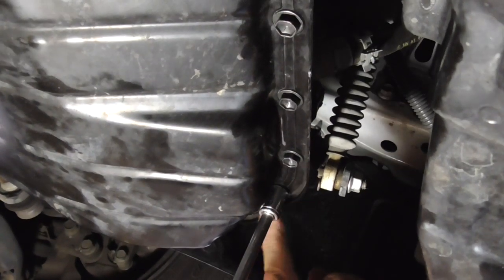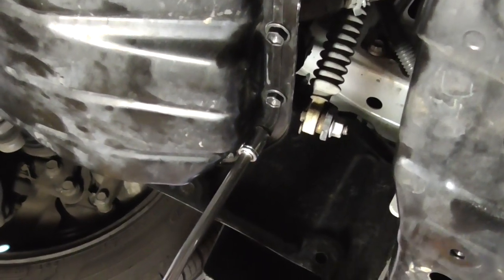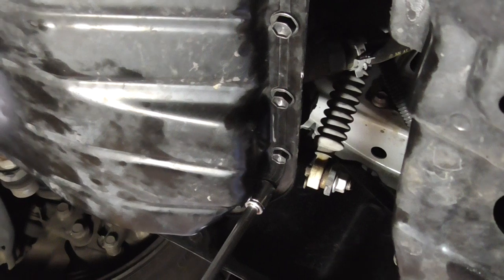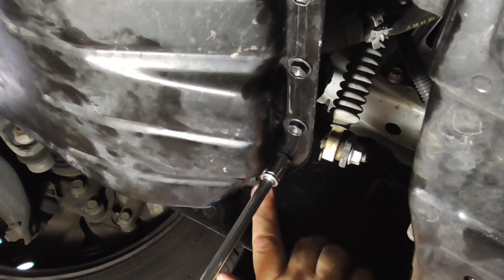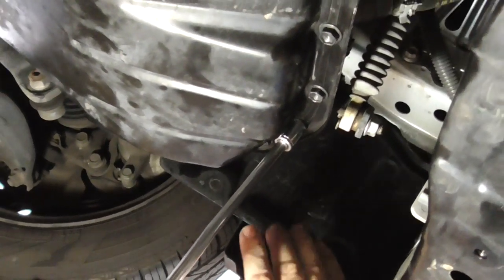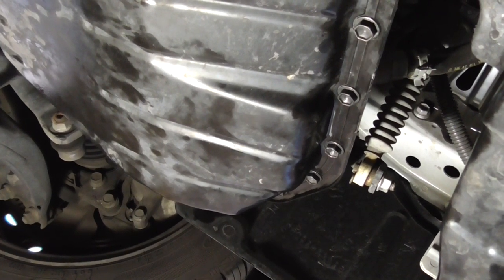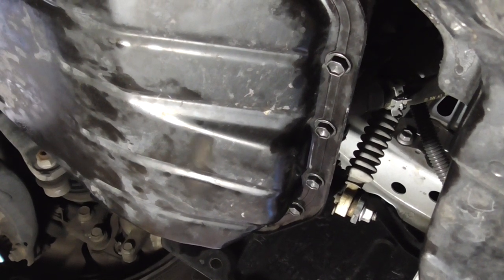We've just been around — about four full circuits — tweaking the bolts up so they're all about the same all the way around. Every time you go around they seem to loosen off, and then finally about the third or fourth time around they stop tightening. Remember, these are low torque — about ten foot-pounds — so they're all pretty much the same. There are two that are very close over on the left front of the vehicle; those tighten up a bit more because they're so close together. Definitely don't overdo it, because you'll end up with leaks in between the bolts.